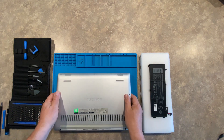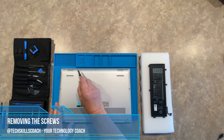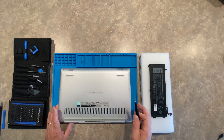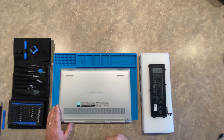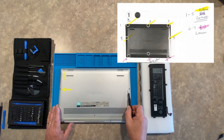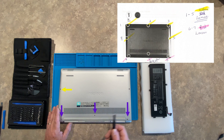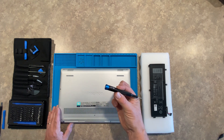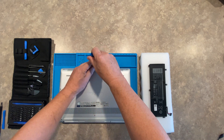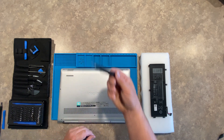Once the device is powered off, we are going to take the screws out. On the Inspiron, when you get your part — which is the Dell 56-watt battery — it will come with instructions. Those instructions state to remove the five screws up here first and loosen the base screws on the bottom. The iFixit tool is fantastic for this — it's got a little holder where it rotates, so I can hold that in place while I twist or rotate the screwdriver itself.